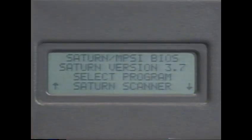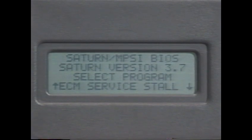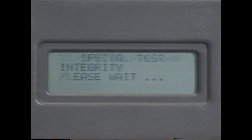The TCM and ECM communicate with diagnostic equipment via terminals M and A of the ALDL connector, located in the passenger compartment under the dash. If the vehicle is equipped with an anti-lock brake system, it also uses the ALDL connector. Once the diagnostic request circuit is completed, the ECM and TCM perform diagnostic tasks.